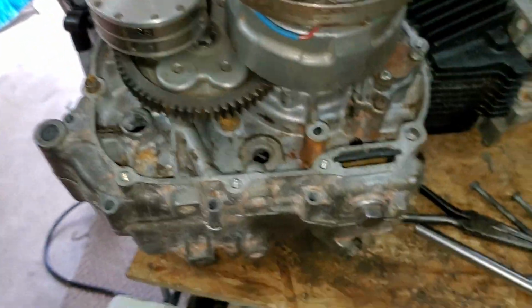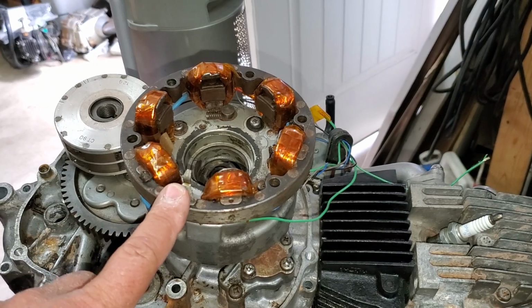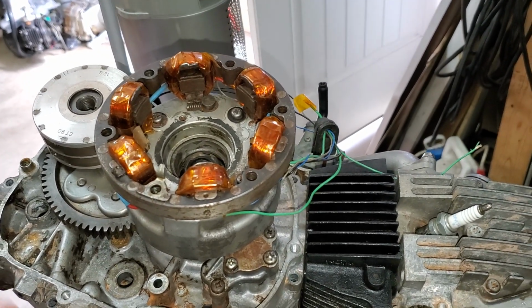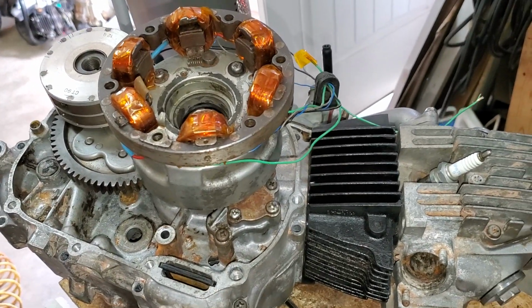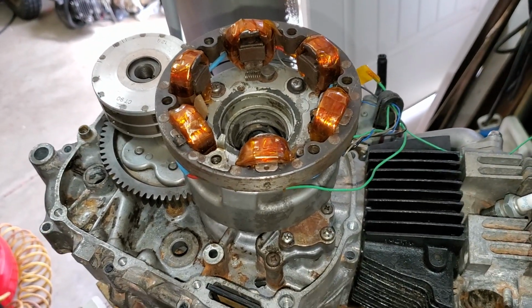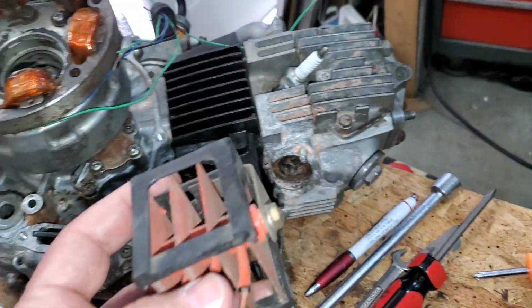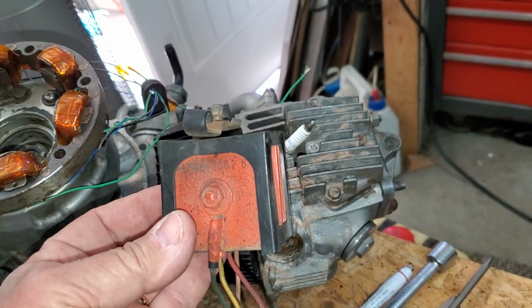Now, the way you charge a battery with alternating current: because it's DC, it will only take a push charge. If it's alternating, like in the diagram, the current's just going back and forth and never moves forward to push current into the battery. So what you end up having to do, and there are different ways of doing it, and this is one of them, is the one that Honda used for years.